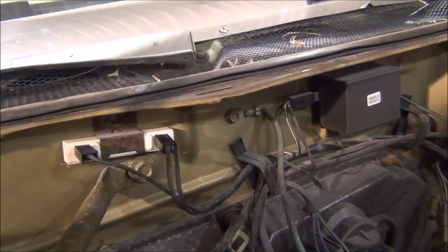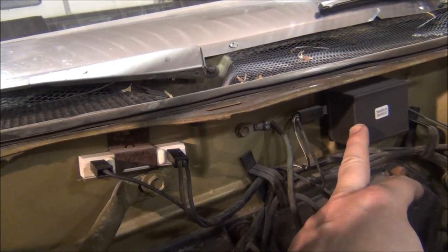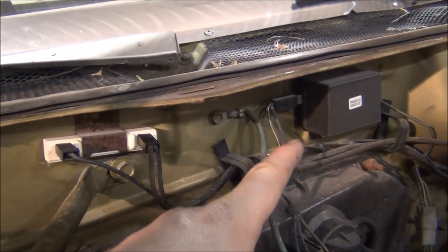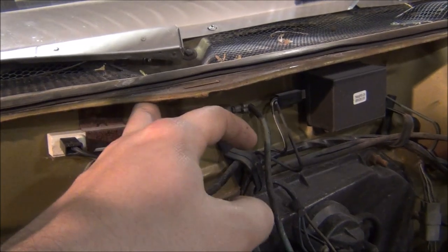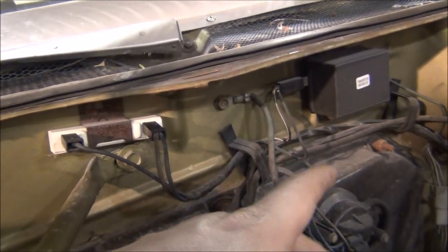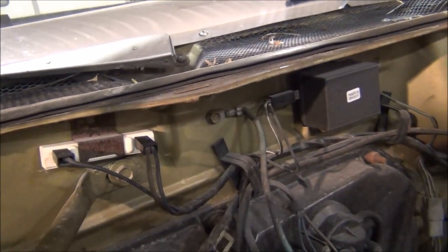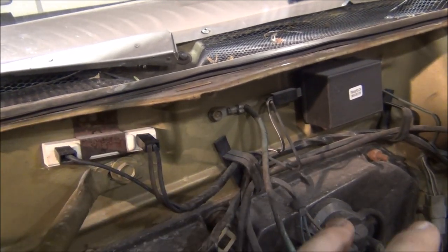Here's a little theory about Mopar ignition. This is the voltage regulator — the old non-electronic one — and this is the ballast resistor. The wiring is fairly simple. It's actually the same whether you have the 5-pin, the dual ballast resistor, or the new voltage regulator. The dual ballast resistor just has an extra row for the extra pin on the ignition module. The wiring is easy to find for the 2-pin resistors, but harder to find for pre-69 and older cars. You need two sets of voltages — voltage to run the coil, and voltage to run the coil while cranking.